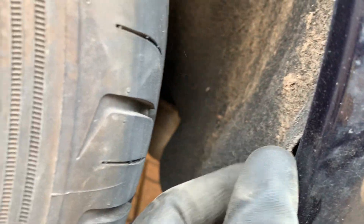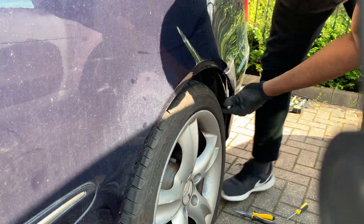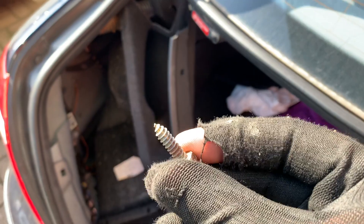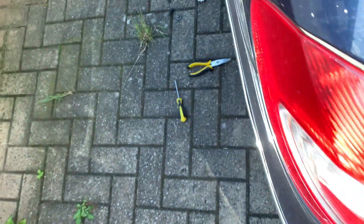That allows you to remove the mud guard — you just pull it like this and then you get access to the screw in there. I'm going to tackle that now, I think that's a 10 millimeter as well. There's another one right there and I think that should be it. It looks like we might be able to take off the bumper now.